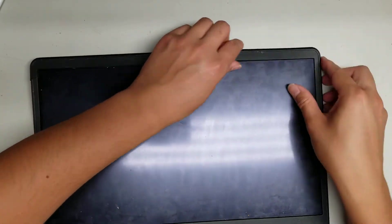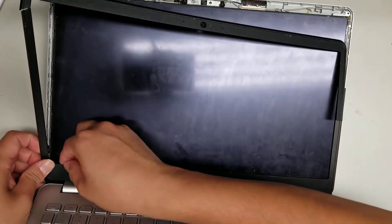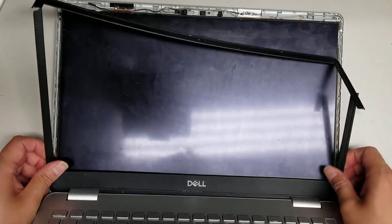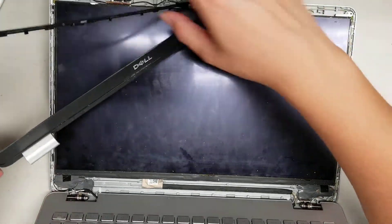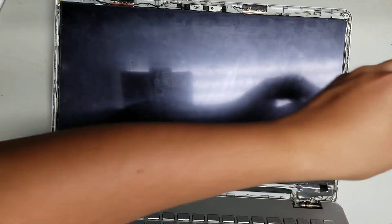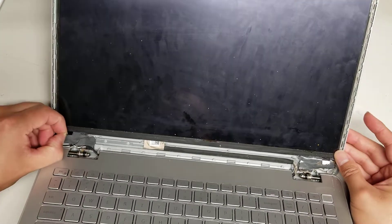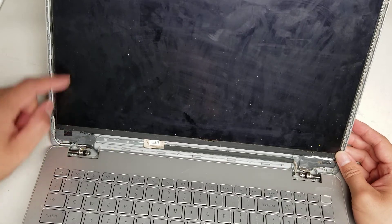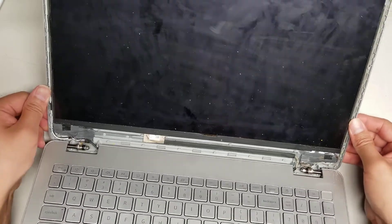This one — they actually damaged the screen bezel; it's broken in half, that's why it's kind of falling apart. The bezel just comes out like that — that's how you remove it. As you can see on this screen, it has these little pull tabs. This is a stretch release adhesive. To get the adhesive out from under the screen, pull it as straight back as you can — don't pull it at an angle or upward; pull it out straight.